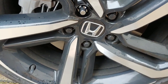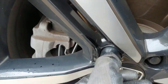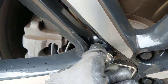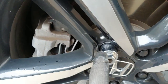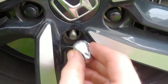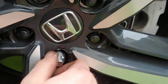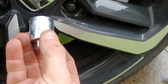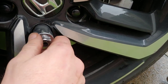On this side I already have one in, but on the other side the rim fit is a little tight — maybe over time it'll glide easier. Overall it's still nice. I torqued this down to 80 foot-pounds. I removed the Honda one and I'm putting theirs on.